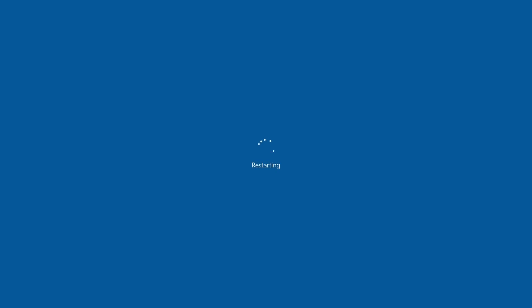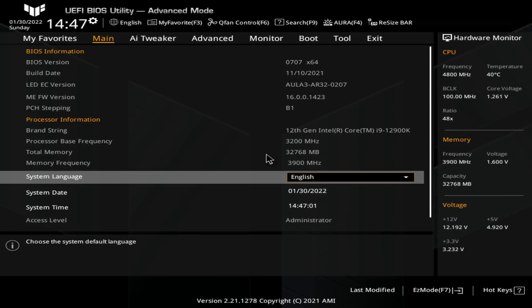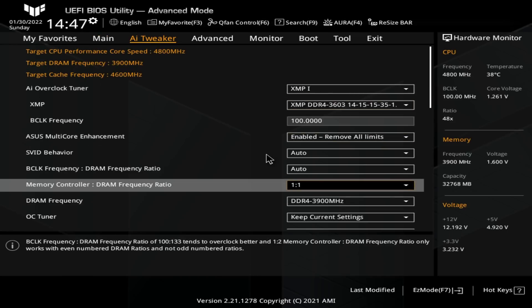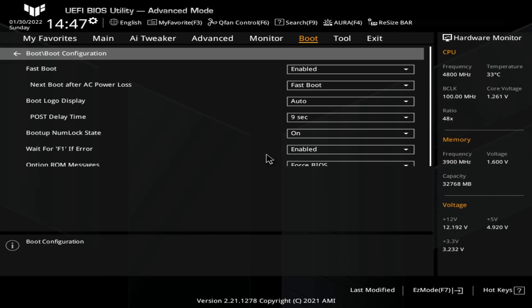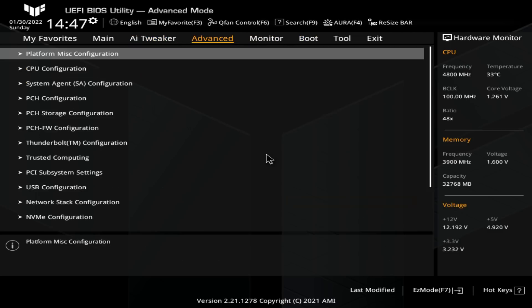Windows is really taking its time to restart. This board is so annoying — I've maxed out the boot up delay in the BIOS and it's still very regular that I miss the BIOS. It goes up to 10 seconds but it isn't helping. It still managed to miss the boot up. This is the only board I've ever run into this problem with — everybody else's motherboards boot up slowly enough that it isn't an issue.